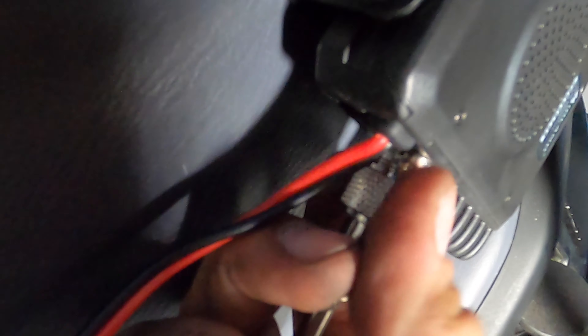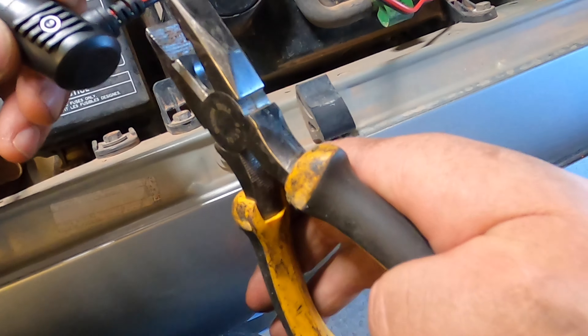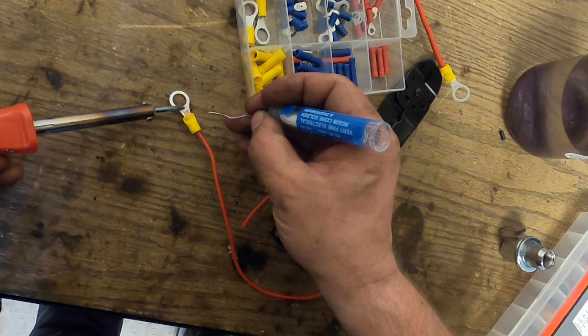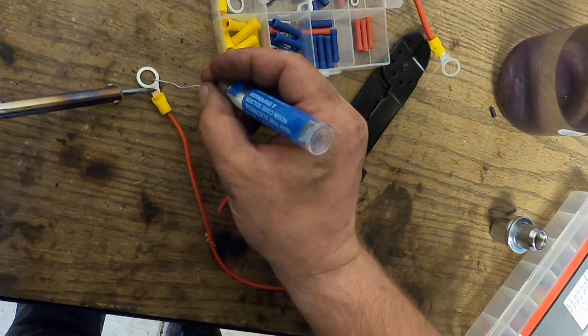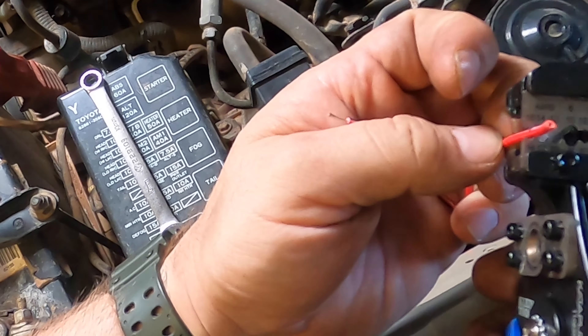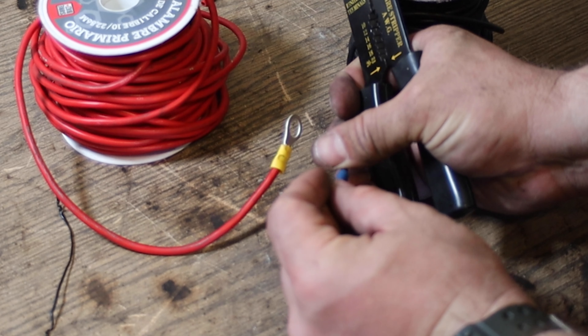Once you've got the radio mounted in the bracket, go ahead and connect the antenna and power cables to their respective spots in the back of the radio, then finish tidying up the cables in the cab. Next, clip off that 12-volt connector at the end of the wires and patch in a set of connections. I ended up needing to build extra leads so both the positive and negative wires could reach their respective destinations, using 14-gauge wire and some crimp-on post connections from my electrical kit.